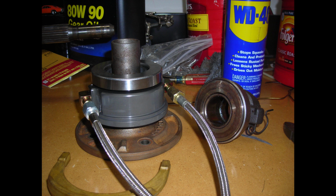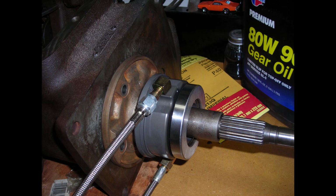There's actually a newer piece that you can buy from McLeod that lifts that up another maybe 3/4 of an inch to an inch or something, so that the throwout bearing doesn't have to go so far out. There's a threaded adjustment inside there, but it doesn't really go far enough for it to clear out at the edge of its throw. So I think when I take my clutch out next month and get ready for spring racing season, I'm going to buy that, like a $60 adapter that pushes that throwout bearing out another, I guess it's about 3/4 of an inch. That's all I got.